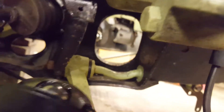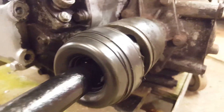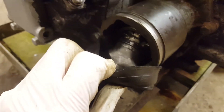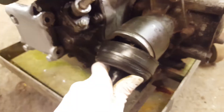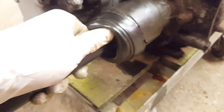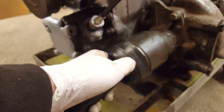Then all you do is put your shafts back through that hole and into your gearbox, and the other end through the bottom of your discs. Just for easy demonstration, here's the engine out of the car — so all you do is put that in like that, and then peel this back. There will be a sachet of the appropriate grease, and you pour that in — just the one sachet, no more, no less. Then you work that up over the lip, and then cable tie, or use your metal straps if you have one, and that'll be that done.